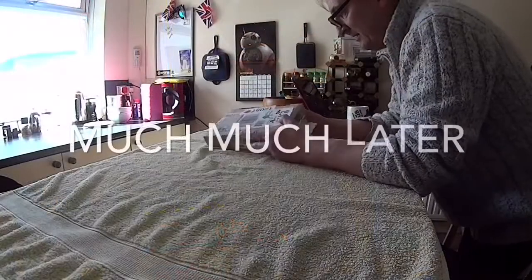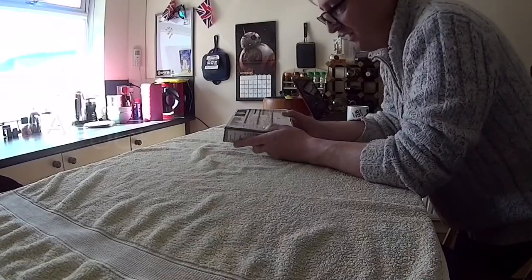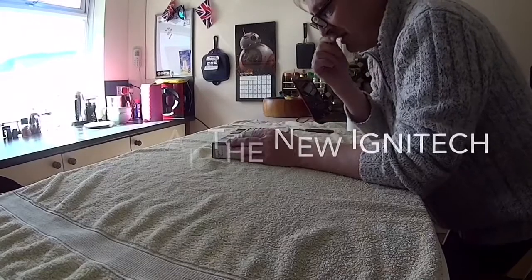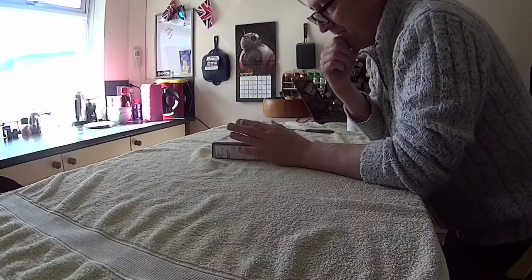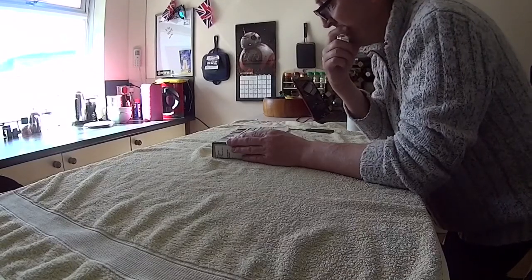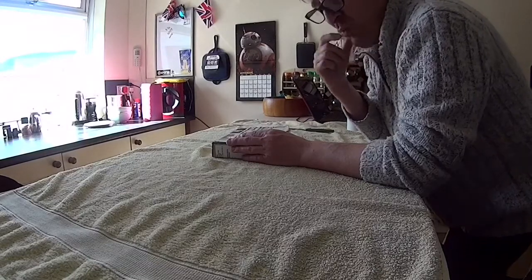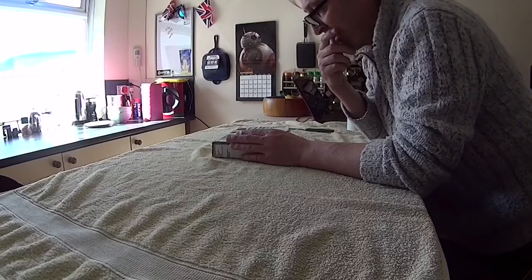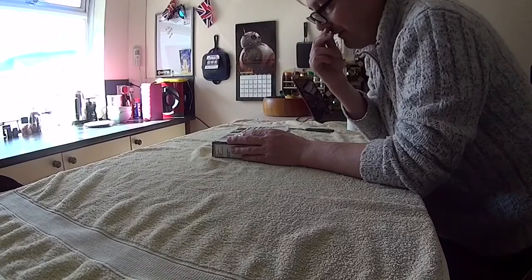Right, so guys, or guys and gals, it's been a couple of weeks now since I took the CDI off the Honda CX500 in 1981, and I've already said I've done the stator test on the bike. I'll show you the actual readings of that, and I'll show you all the pins and what you check. But essentially what it told me is that you need to replace the CDI or the stator, one or the other.